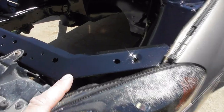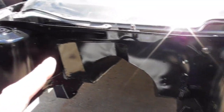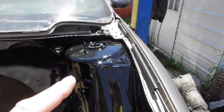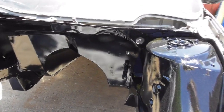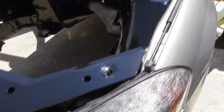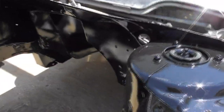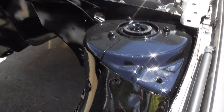Here's under the hood — this is all nice and black. Firewall. I used a good quality industrial black paint. It's chemical resistant — it's basically an iron enamel, single stage. So if you spill anything on it, it will not bother it. It's good paint — we use it a lot, especially on frames, firewalls, and underbodies of cars.